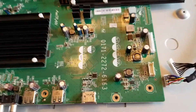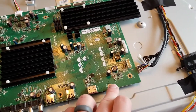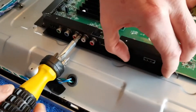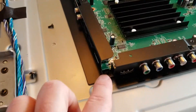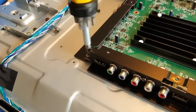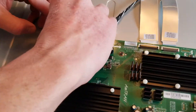We've got our new board down in place — we've just set it back down and lined it up with the screw holes all the way around. This one will be elevated for the guards. We've placed it back on and are now reversing the steps, starting with the screws that connect it directly to the back panel of the TV. Once the guards are back in place, screw in the two middle screws first to keep it steady, then slide the guards right back in — these two holes are shared with the guards for a single screw that overlays onto each other.